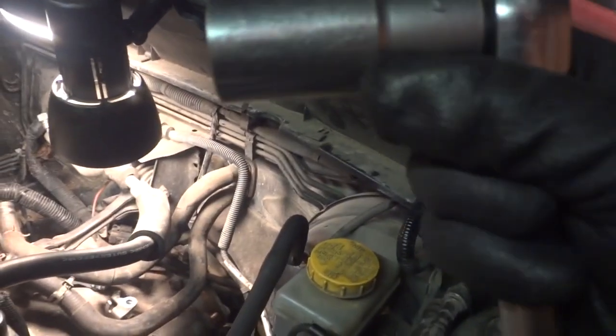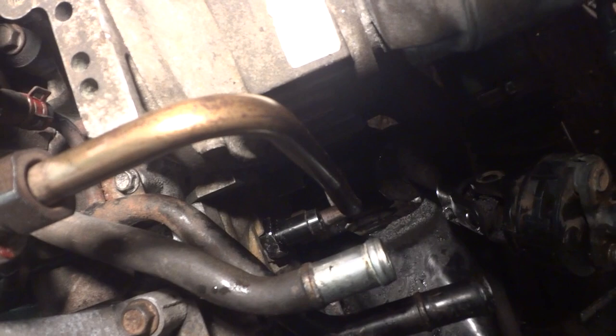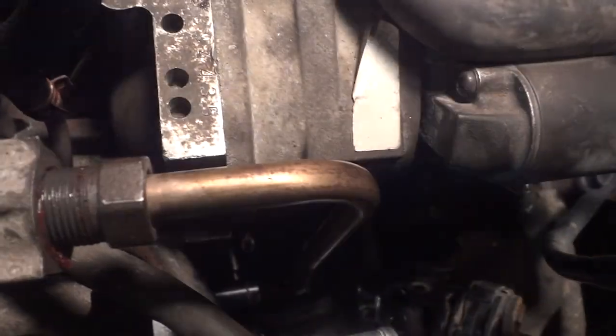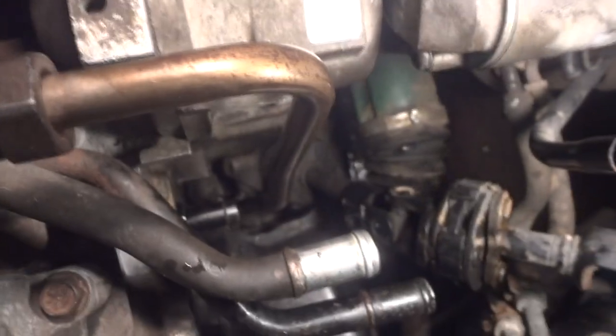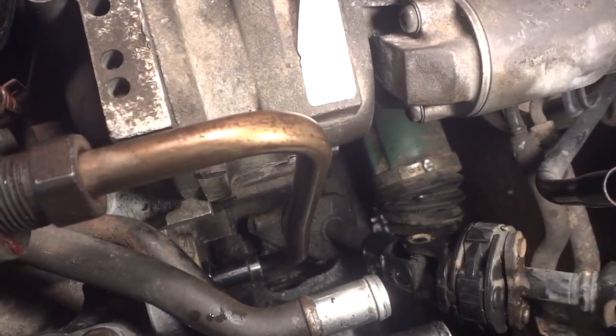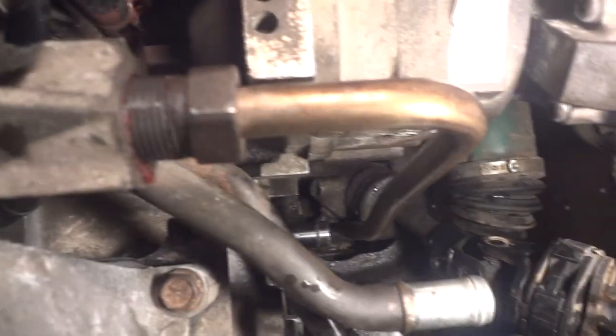I don't know — maybe this wasn't such a great idea. I got the piece in; I had to use a deep-well socket to screw it in. Once it gets in there, there's just barely enough room to keep the socket on it because it goes in so far — there's a raised area in the back of that head that covers up the gripping surface. But it is in. The problem is, you can see right there — when you see the problem, it's directly behind that EGR tube. So if I want to make this work, I'd have to cut that tube and somehow put an elbow in it, bend it, or have it come around on one side. It is directly behind it, so that is not going to work the way I was hoping. There's probably not even a half inch of clearance before it touches.